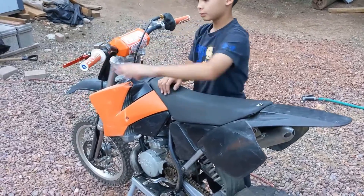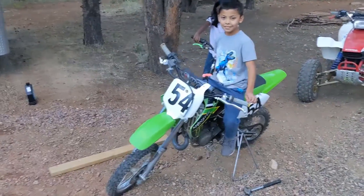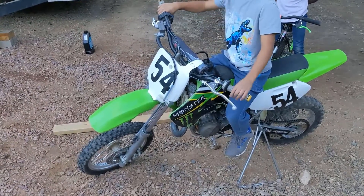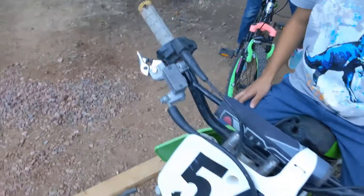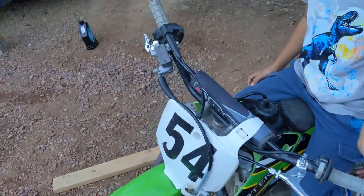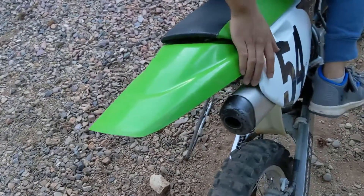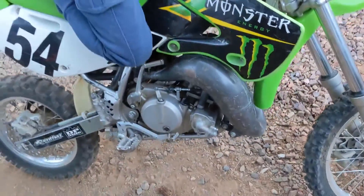So Mason, my oldest — he's 10 — this is the bike we just built. In an upcoming series, you will see my younger son and this bike that we just bought. What kind of bike is this? KX65. Mostly stock, runs great also. There are a few updates we're going to do. He already laid the bike down two hours after having it, broke the brake lever. This is a goofy little aftermarket perch and lever, so we'll go ahead and swap those out for some OEM units — probably the same levers we used on the KTM. We also ordered a new silencer, so this one will have a ProCircuit silencer. It's got the factory pipe. We won't do anything with that yet — he'll probably lay it down again and dent it, so at that point we'll replace it.